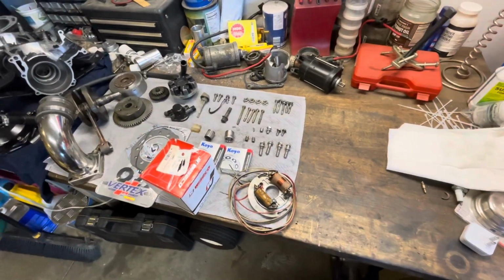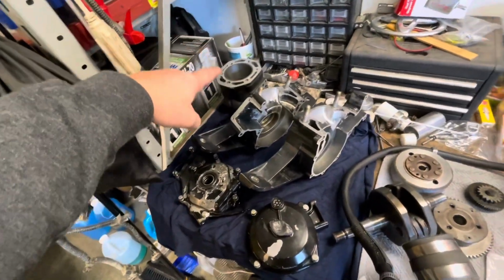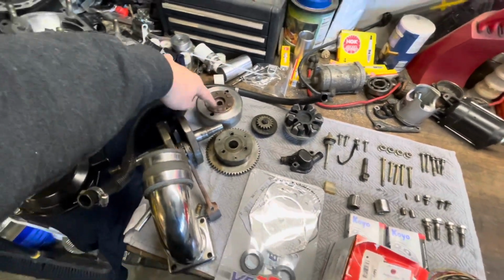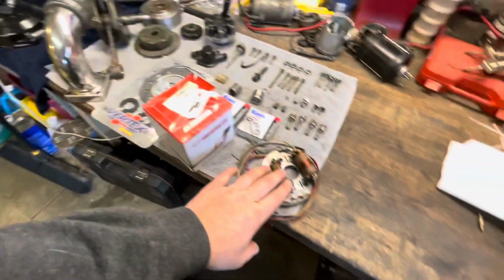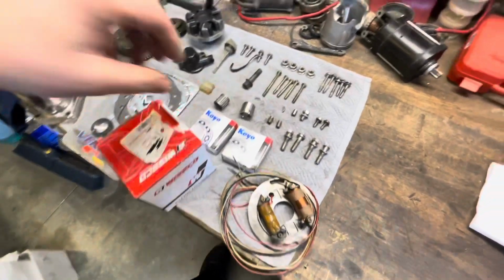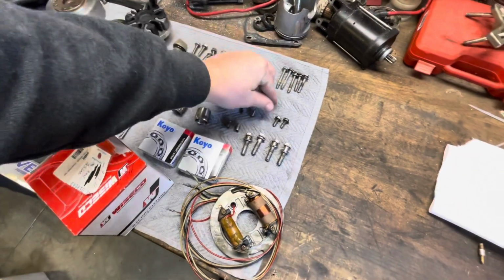So I got my parts all laid out, everything that needs to be installed to complete the full JS300 engine. Cylinders, cases, side covers, manifold, crank, lightened flywheel, about 0.7 of a pound removed, and gaskets, piston for the bored out cylinder, stator, crank bearings, and a new wrist pin bearing for the rod. And yeah, pretty much ready to assemble.